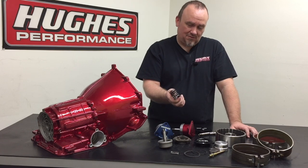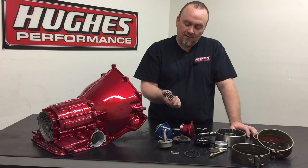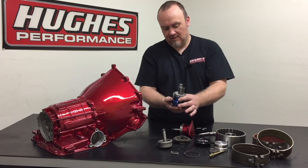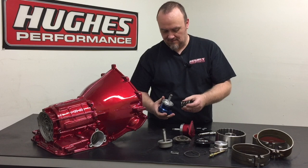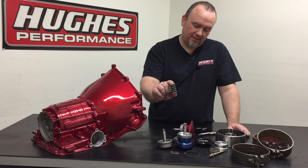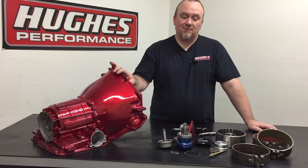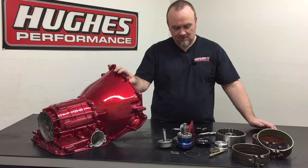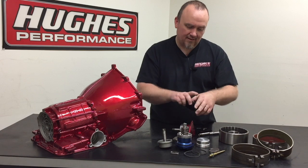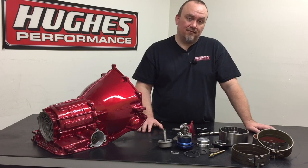Stock springs should only really be used with stock transmissions. We have our own spring that we make that comes standard in all our full manual valve body and trans-brake-equipped transmissions up to 1500 horsepower, and then this spring is out of the Sonics kit and is calibrated specifically for that servo assembly. If you're a DIY builder, make sure you're using the appropriately calibrated spring for the type of servo you're using and how the transmission is going to be used — we can help walk you through that. We also sell all of these parts in kit form so you can buy everything matched together, have a pre-engineered assembly, and bolt it in for immediate success.